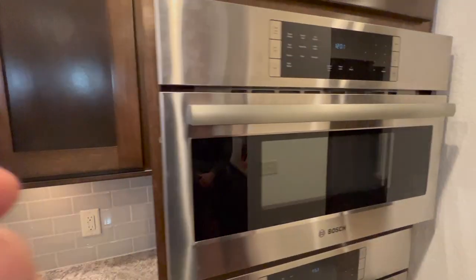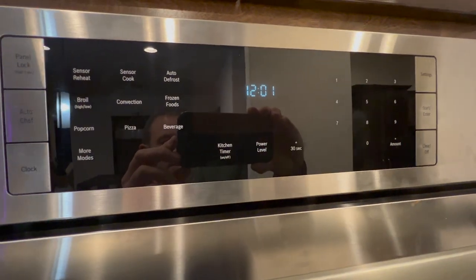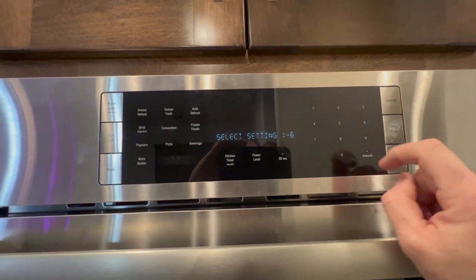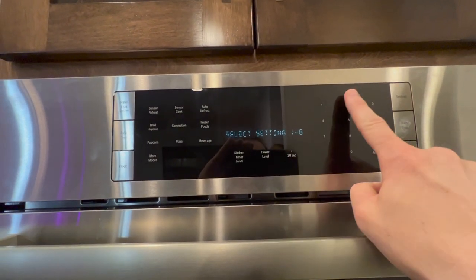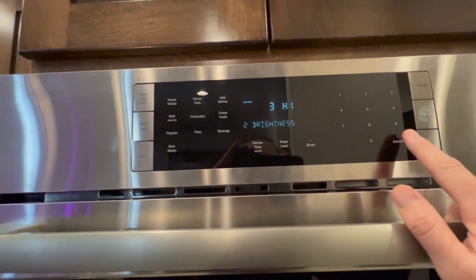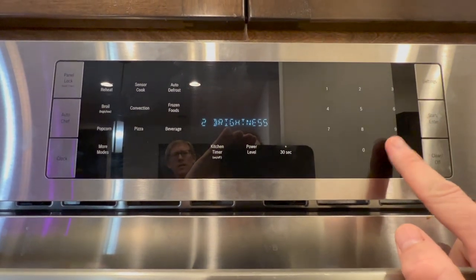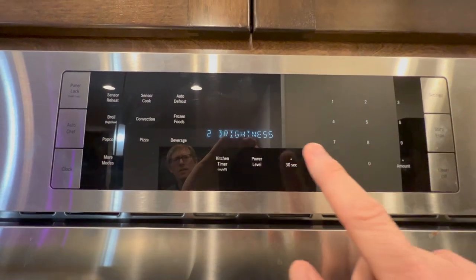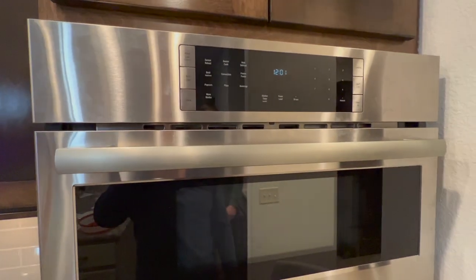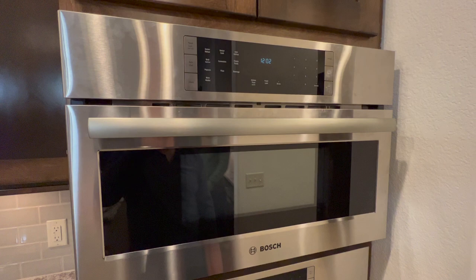Everything is hooked back up. We haven't screwed the screws in yet, but just for testing purposes the control board is back on, and you will see it is obviously noticeably brighter and like new. One thing you want to do is go into settings and select settings 1 through 6 — go to 2, which says brightness — and it is on 3 high. If you want to change it you can toggle by hitting the amount button, then 2, and 1 is low. We want 3, and to select that it's start and enter. If you did everything right, you'll have a new bright board. Thanks for watching — hopefully this is helpful, and all the parts we ordered will be in the description. Give it a thumbs up if this was helpful!